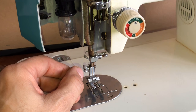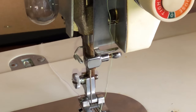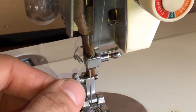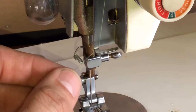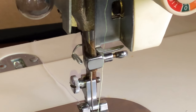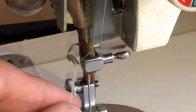We've gotten those guides and there's one more guide to hit before we get to the needle. This is something you always want to look for — I've seen machines where this was missing and you really need it. It's right here, attached to the needle bar. If you're not sure which side to approach it from, just try both sides — you'll know because the thread will rest in the guide. I went around the right side, tugged it gently toward the guide, and there it is, resting right in there.